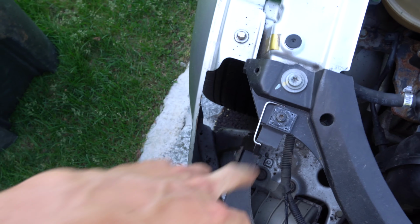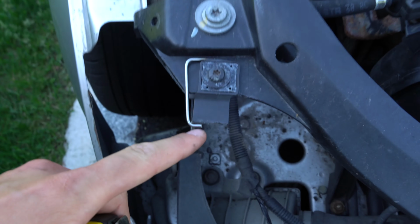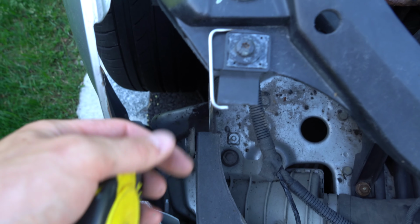So I came outside with some 3/16 stainless filler and a measuring tape, and I made this. I went back inside and I actually had bent this up, but this is 2 inches. And it's just some 304 stainless. I bent it up into place. So this is gonna be my little template, and that's how much I need to have it bent down. So yeah, let's go ahead and trace this out onto some mild steel, some 16 gauge, and make some tabs.